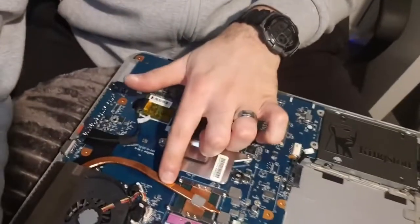That is done - heatsink is on, cleaned out, and the fins are nice and clean so air can escape. All I have to do now is put this back together. That is all you need to do to change the thermal paste on your old PC or laptop - it's the same process with a PC, just a different heatsink. Make sure you do this - it's a cheap and effective way to ensure your PC is cooled correctly and runs properly. I'd highly recommend doing this every one to two years. You can buy more expensive thermal paste if you like, but this is a sure way to ensure your PC runs efficiently.